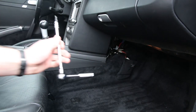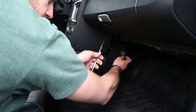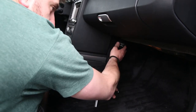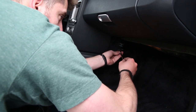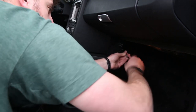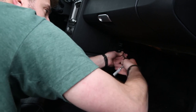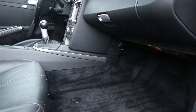And then finally the carpet piece with the outlet on it. So remember, as I mentioned, the screw does not separate from the carpet piece. So simply slide it as far forward as you can after you've changed your bit to the T25. Slide it as far backward as you can, lining that screw up. Find your access hole and tighten that in there. Now, just before you snug it up, you'll want to just kind of adjust the carpet so that it's as far back as it can go, covering up any gaps that there may be. Okay. That looks good. Now we're ready to move on to the front.